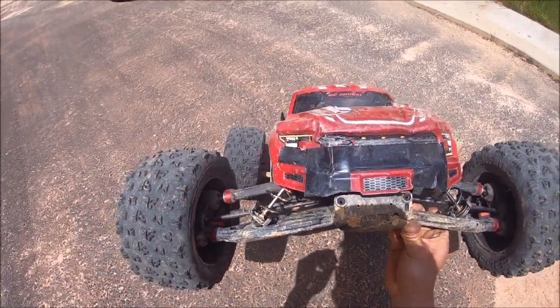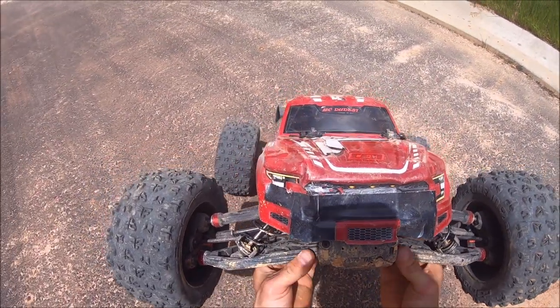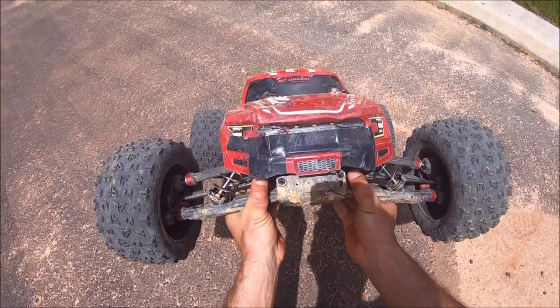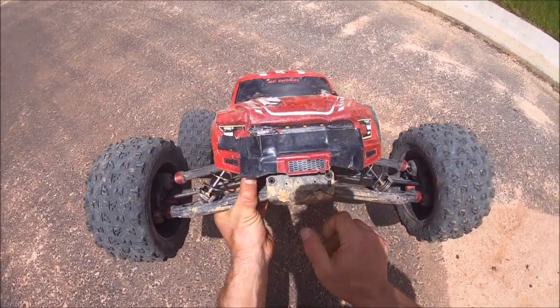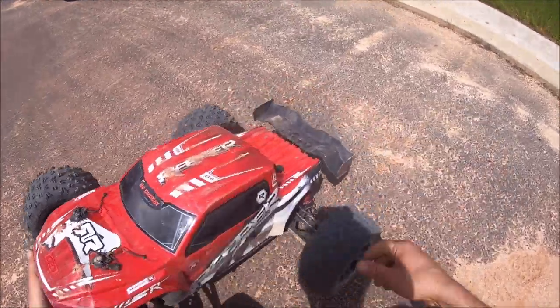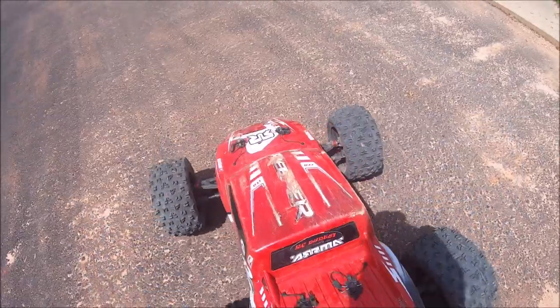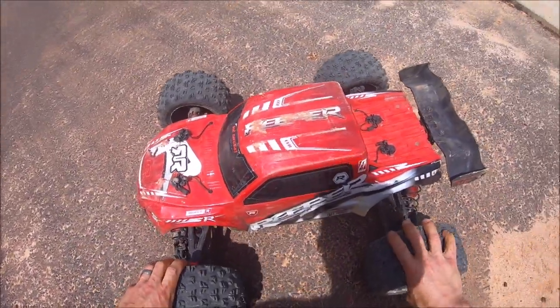Again, adding the droop screws in here, and then the M2C pistons to kind of smooth the shocks up, keep them from locking up under hard launches, definitely helped. But adding these hardened shock shafts definitely made it 100% better. So the front and the rear look really good. So huge shout out to M2C for that, Mitch Looper.